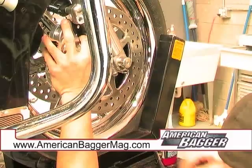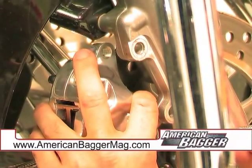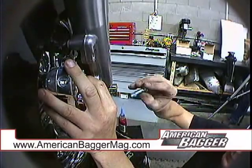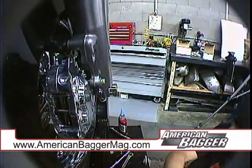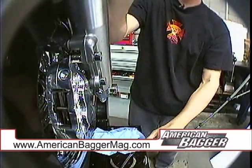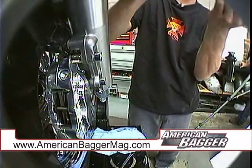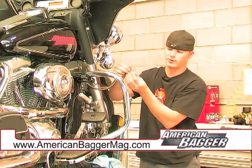Place it around the rotor and just slide it up into place. You can see that we're going to need spacers on this one, which are provided with the kit. Hold your spacer in and place a little bit of blue threadlocker on the bolt, holding the caliper and spacer in place and using the Hog Halter's bolt with some blue threadlocker on it. We'll get our brake line back down and remove the Harley banjo bolt, then use the banjo bolt from Hog Halter's with their copper crush washers.